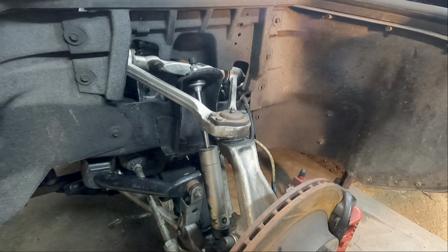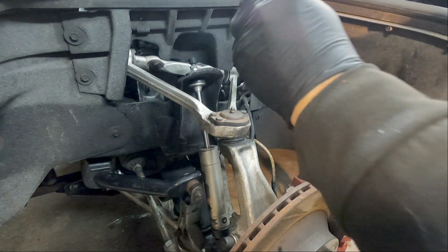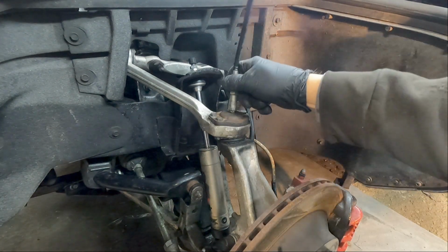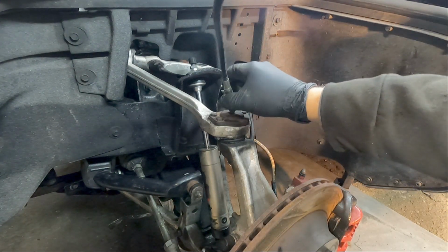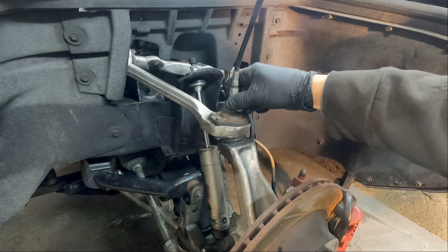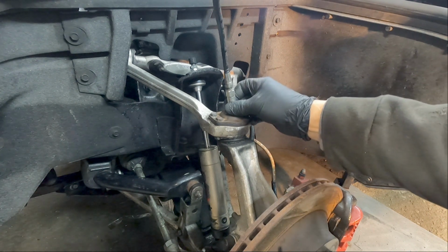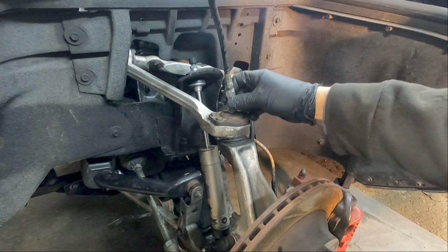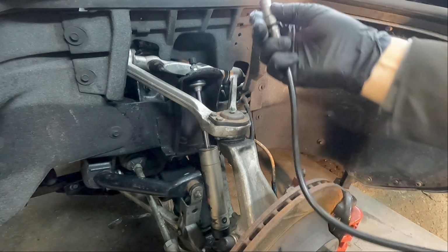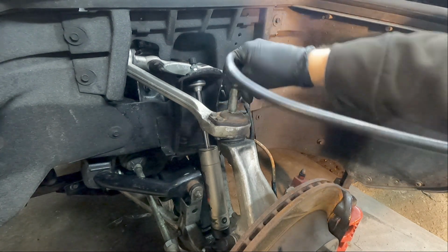But one tip I want to give is when you use your grease gun, if you don't have one of those fancy ends like I don't, with the little lever on it that automatically releases it, something to keep in mind. Because like right now, see how I just tightened this up? I keep this loose, and the reason I do that is, here, let me loosen it up again, take it off, and tighten it up. I always leave that loose because, like right now, it's tight. I'm going to put it on there, and I can't get it off.